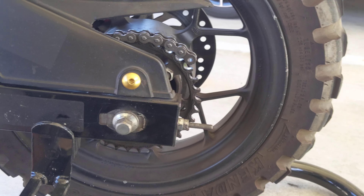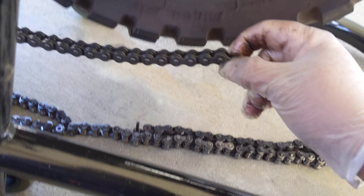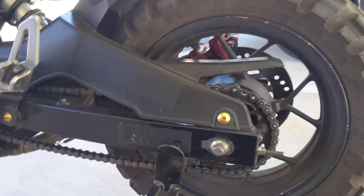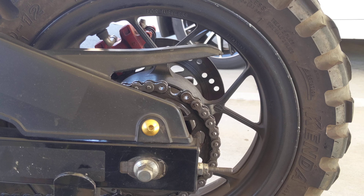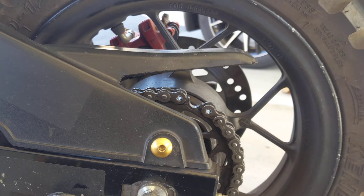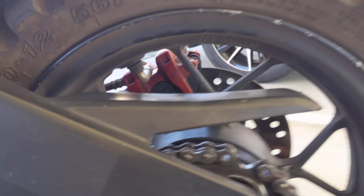I'm going to try to get this about here, that way it's set down. Take this link off here. I'm going to probably need to do this with two hands. If I need to adjust it to get it close, this link here should sit right there, and then the master connects it. As of right now it's connected but we're missing one link. I need to loosen the axle so I can tighten it and push it in — that way it reduces the slack. Just a 14 and a 19 to reduce the slack. This link should be able to reach there and then I can put on the master link. It already came greased, as you can see. Once that master link goes on, it's just tidying it up, adjusting the slack, and calling it a day.